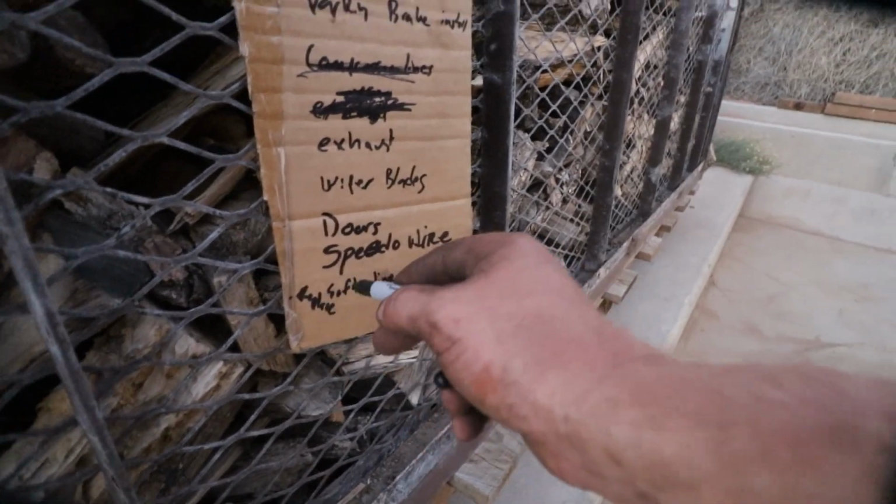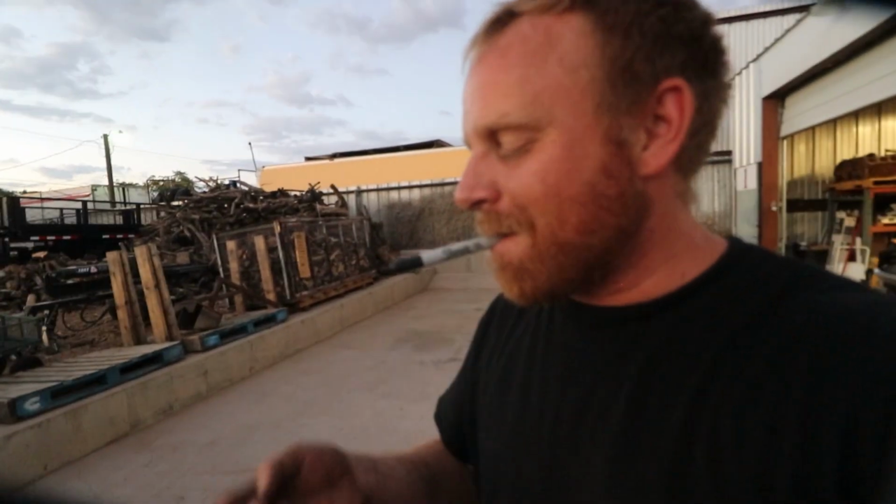And I gotta replace the soft fuel line for fuel, just so you guys are aware. You can't have long amounts of soft line. So all of this being fuel line, all has to be changed to the hard line, so I gotta knock that out too. So other than that, pretty close. Let's get a good couple close-ups of the truck and probably call it a night.